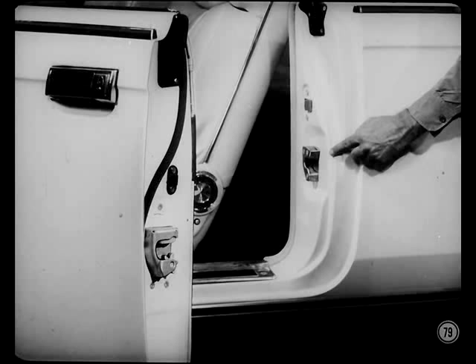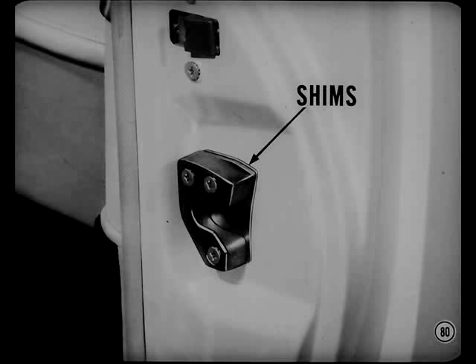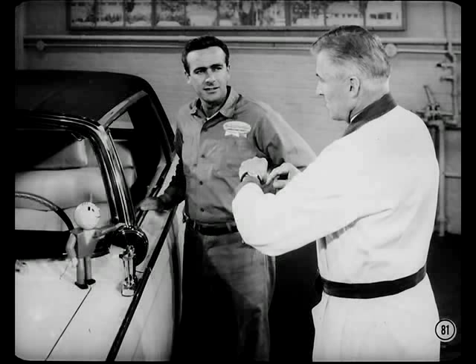Do you have any suggestions on the new door latches used on most of our new models? The new latches are even safer and more reliable, but there's nothing new to learn. You adjust the new guarded safety door latch the same way you adjust the previous latch. But don't forget to reinstall the shims between the striker and the pillar if you ever remove the striker.